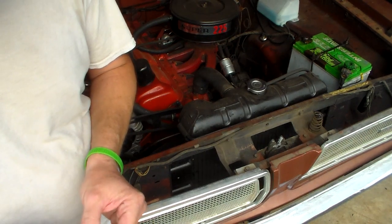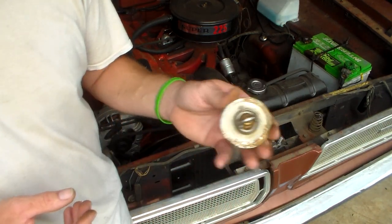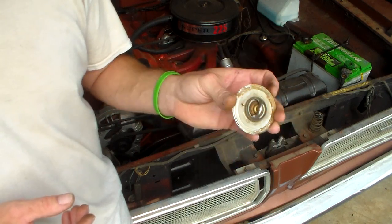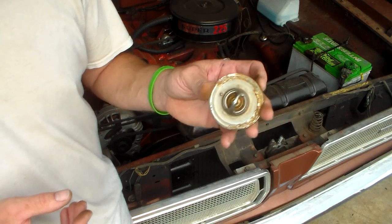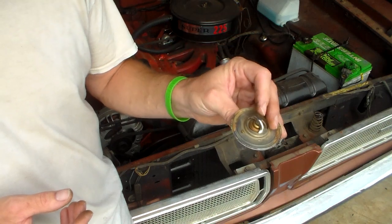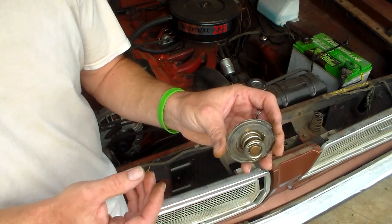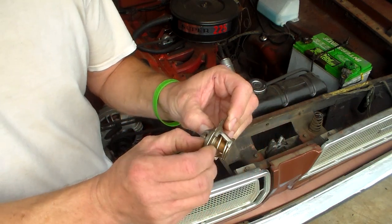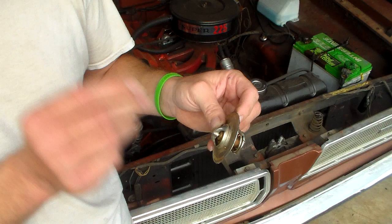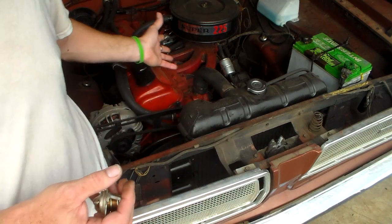Anyway, I hope this helps you learn about this. Don't let people tell you wrong — do the research on your own and learn about these things. That's what a thermostat does: it does not help an overheating situation at all. The only way a thermostat will cause an overheating situation is if the thing sticks all the way closed — then you have sudden catastrophic overheating that does not cure itself. The engine overheats right away and keeps doing it until it's dead. Even a slant six.